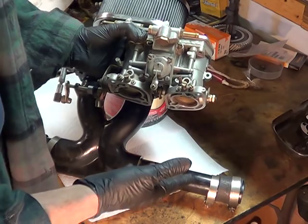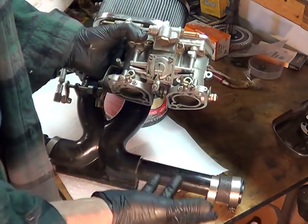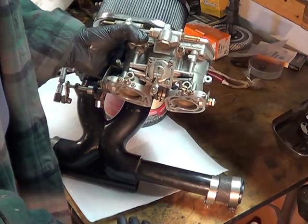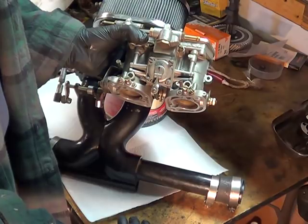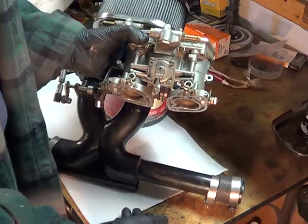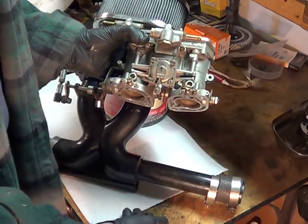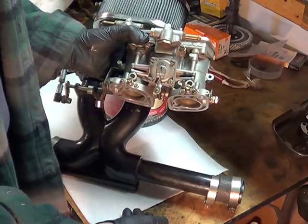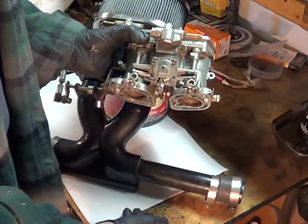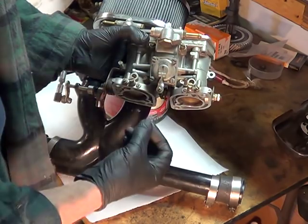It's what's below this that draws the actual fuel-air mixture in. I can't tell you how many times I've been to the sand dunes and somebody buys a sand rail with one carburetor or two — doesn't matter. They get it out there to the sand dunes, it's running bad and they're frustrated, but it'll run wide open. What you want is drivability. You need to tune that carburetor.